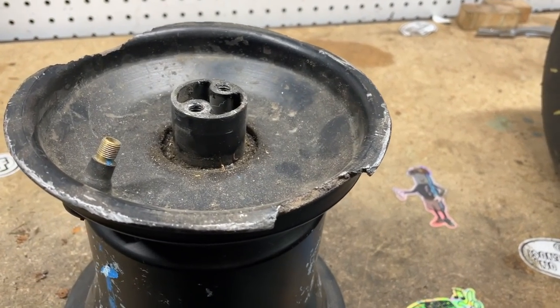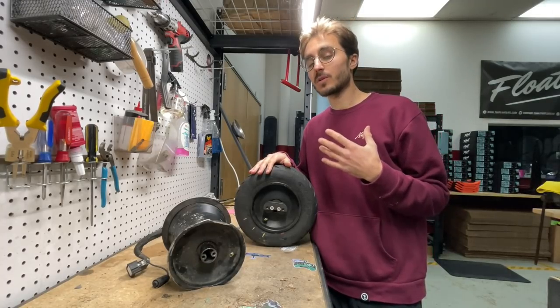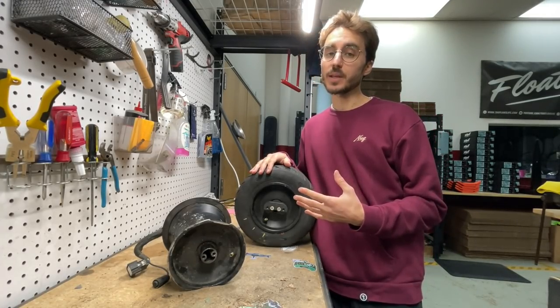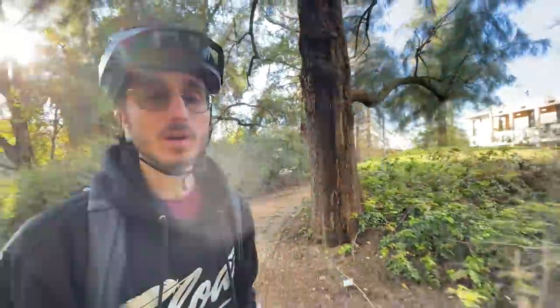And when it hits the hub, it can crack and break the hub. And when you combine this with the added weight of the GT, the problem gets even worse. When I ride trails on my XR, I'm usually riding with a tire pressure that is slightly higher than I prefer, just to be on the safe side of avoiding rim damage.